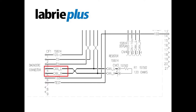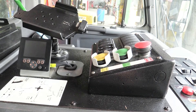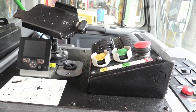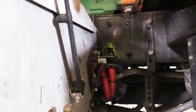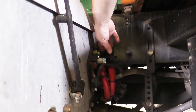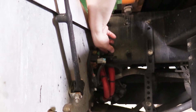This location enables you to verify that both terminating resistors are in the circuit, equating to a reading of 60 ohms. CAN bus resistance must be measured with the ignition and battery disconnect in the off position. Please remember that on Automizer and Expert vehicles, modules 20 and 30 are connected directly to battery power and will therefore still be active if only the ignition is turned to the off position.